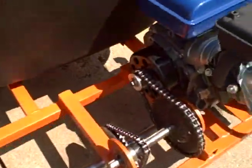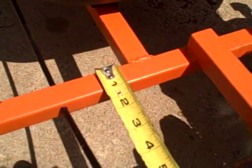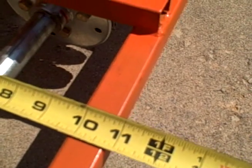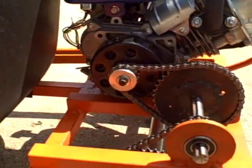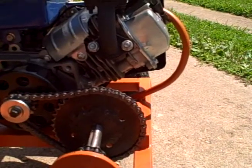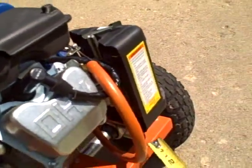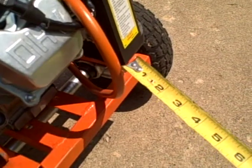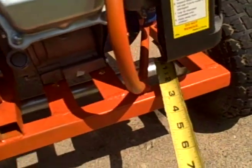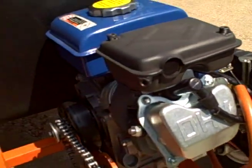The engine compartment area from tube to the back tube is 10 and three-quarters of an inch. That gives you enough room for where I mount the seat so that the engine doesn't go too far beyond the back of the frame, and you can fit the jack shaft and everything else in. With this engine, since it's a rear pull for the carb, I just bent some steel tubing and ran my throttle cable through it so it comes out from underneath, around, and then back up to pull the throttle properly on this 2.5 horse engine.